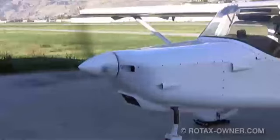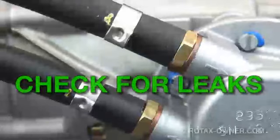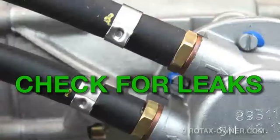Now that you have an appropriate pressure gauge attached, make sure that everything is secure in place and is safe for an engine test run. Start and briefly run the engine, then shut down and thoroughly check for any leakage at our fuel line crimps on the fuel pump. With a leak-free installation confirmed, start and run the engine at various RPMs, verifying that the fuel pressure remains within limits at all RPM ranges. Note that pressure readings will fluctuate at different RPM ranges — likely the pressure will drop when coming down from high RPMs, and then raise back up when idle RPM is reached.